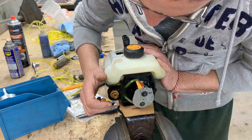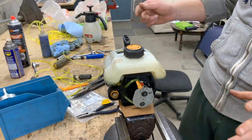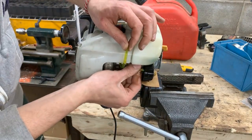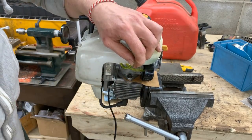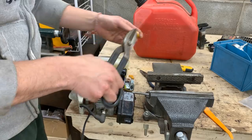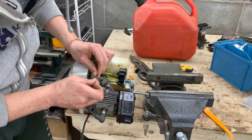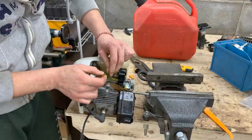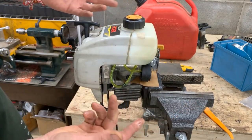Choke. Yeah, this bulb is gone. It's gonna start leaking. Okay, that's not gonna work. What we're gonna do is we're gonna eliminate it. So I'm gonna disconnect this and this. Shoot. Let go. Okay. So we're gonna use this as a connector, and we're gonna just bypass the bulb for now until we get the one on order. Looks like we have fuel in the carb, so